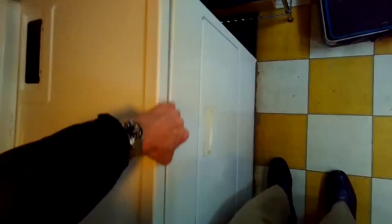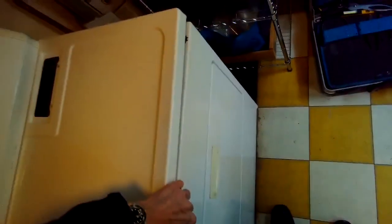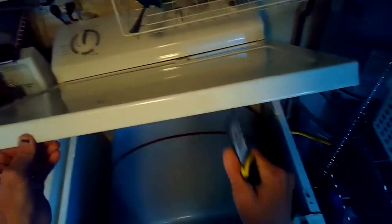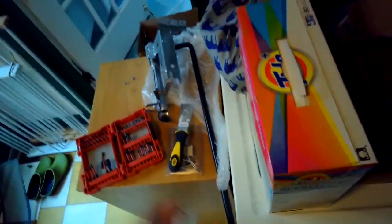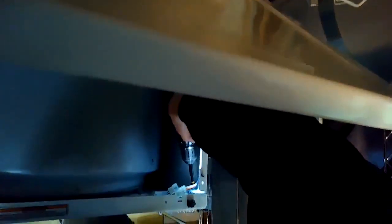So to get this gas valve changed, we're going to be removing the top panel by pushing in on two clips that are on the right and left side, about 2 inches in. Push in with a paint scraper. And then I'm going to remove the modular connector for the door switch. So I pry that apart, and I'll remove two little screws that are holding in the top of the front panel in the upper right, upper left-hand corner.